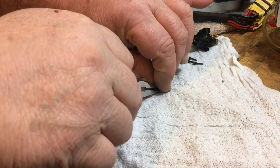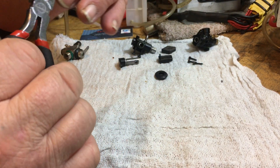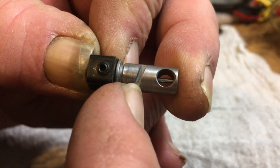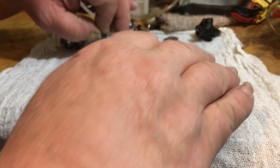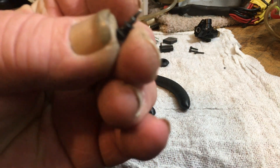This is your adjustment needle, and a friend who is one of my subscribers turned me on to this tip: you cut one coil out of the spring, then you sand down and round off the very edges. There's a slot that is rough-ground — you'll take skin off if you just slide your finger on it — so sand that down, round the edges, round the screw. Take one millimeter, which is about one coil, off the spring and put it back in your engine.